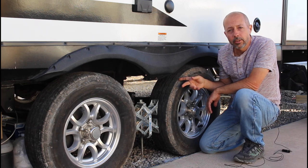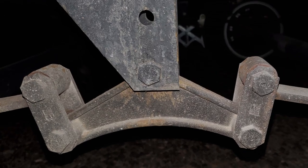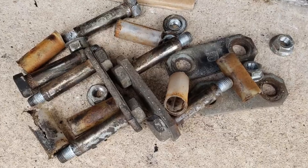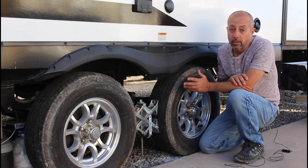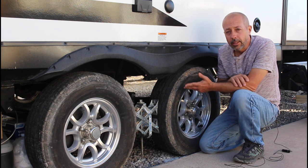The thin plates and nylon bushings that come standard on most RVs are not super durable and often showing wear within a year after purchase. When the nylon bushings wear, bolt holes can become elongated, throwing the suspension out of alignment. In severe cases, this can cause the springs and shackle plates to become detached from the chassis.